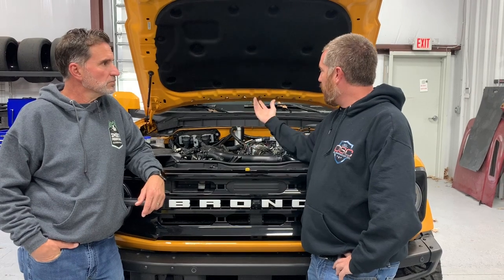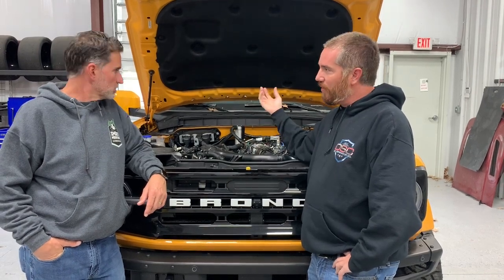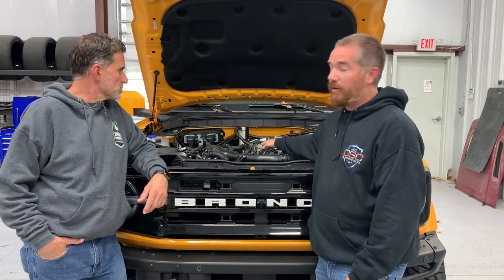Sure. So, yeah, it's atomized oil, because the filter in the oil separator is what turns it back into oil. It's just like a film in the air, and then the filter condenses it and allows it to collect. And when you see that can, it's a mixture of oil, fuel, moisture, all kinds of nasty stuff that you don't want in your intake tract.